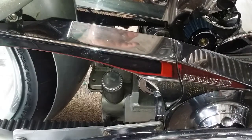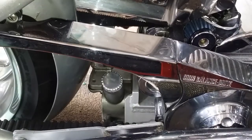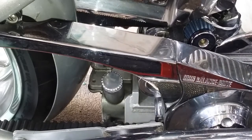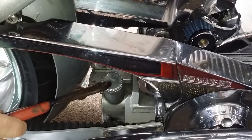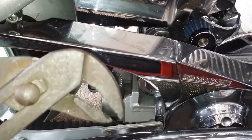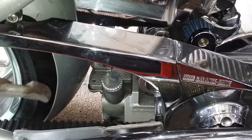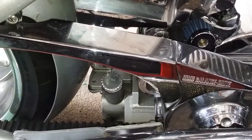There's been some confusion even with Big Dog owners about how you check your oil level and how you put oil in these. This is your oil tank cap. Some Big Dogs have the push-on ones; this one unscrews. You have to use channel lock pliers to get it off because mine is a little tight, but that's also where you put oil in when it needs it.